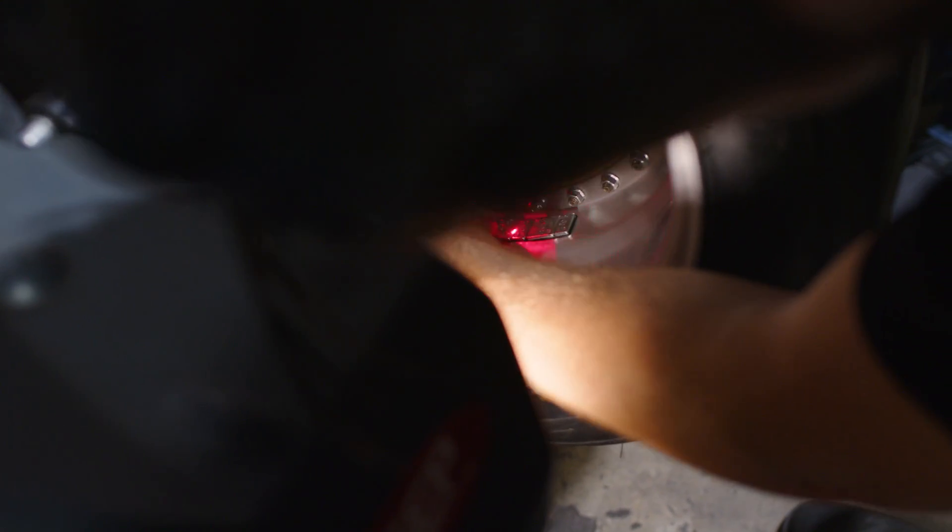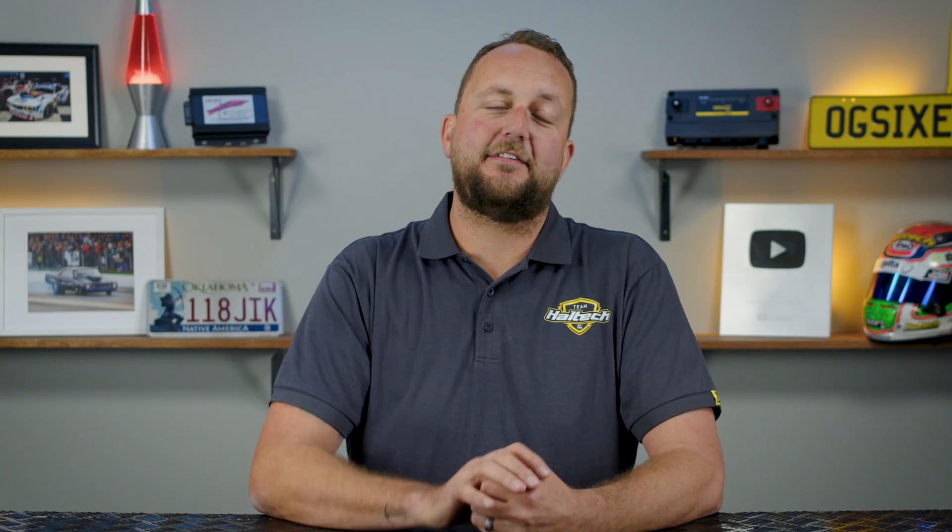If your car's got knock-on weights, it's best to take them off for the dyno session and preferably get the stick-on style weights that go on the inside of the wheel barrel — that way there's no chance of them flinging off and hurting someone. Also make sure the tyres are at their intended operating pressure; normally 35 to 40 psi will do the job. The tyres should have plenty of tread to get the best grip on the dyno for the best power readings. And make sure you have one wheel nut per stud on the wheel.